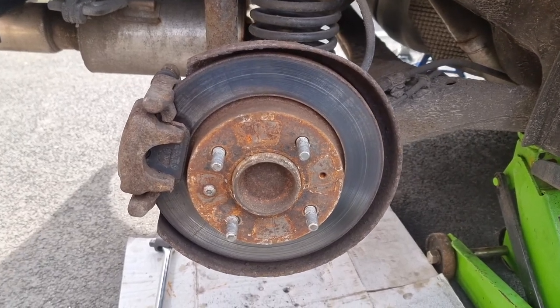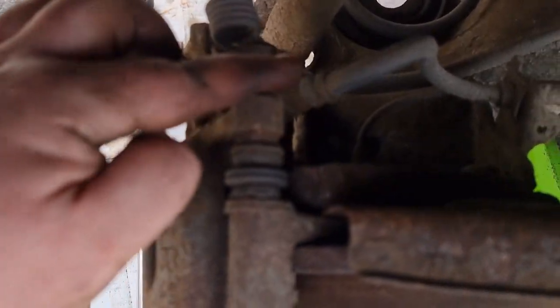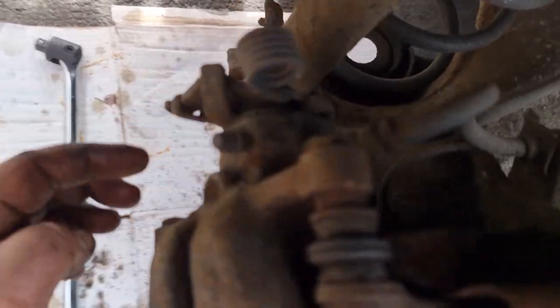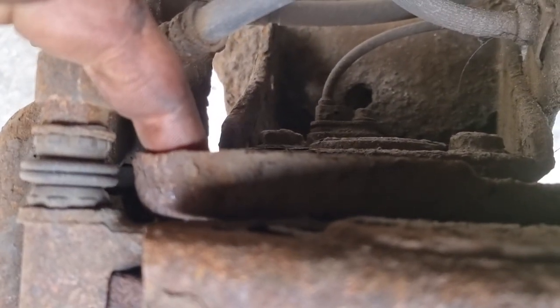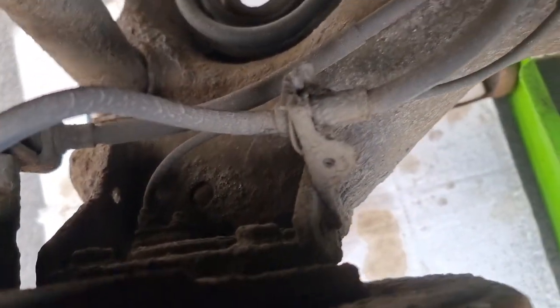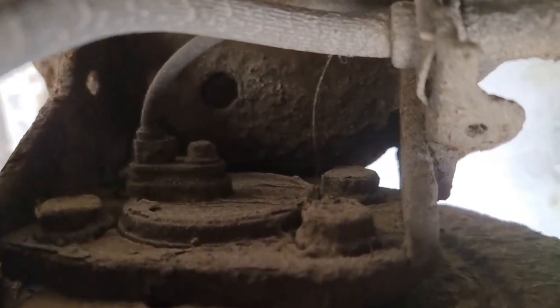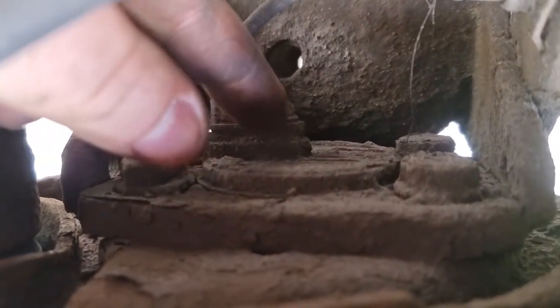I have come across a few struggles along the way, so I'll show you with the other side. First of all, you want to spray some penetrant oil in a few areas: the screw holes, the brake disc, the brake pad carrier bolts — there's one here and one in the back. Then you've got a bolt here and a bolt towards the bottom that holds the caliper to the hub itself. And then you've got these four bolts that hold the actual bearing in, and there's a little female Torx bolt that holds the ABS sensor on.